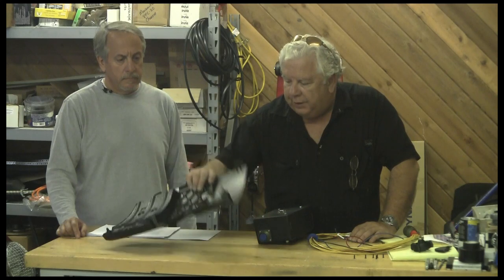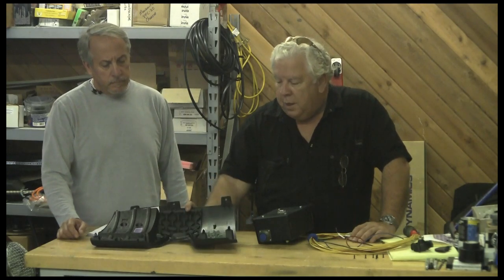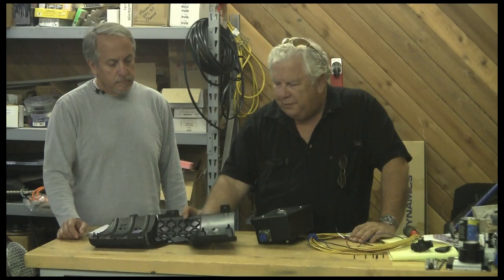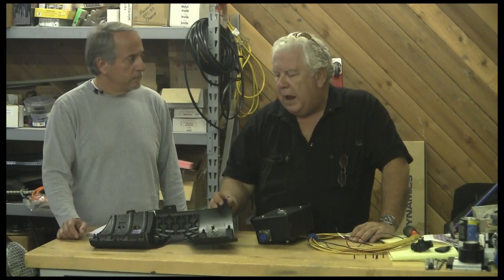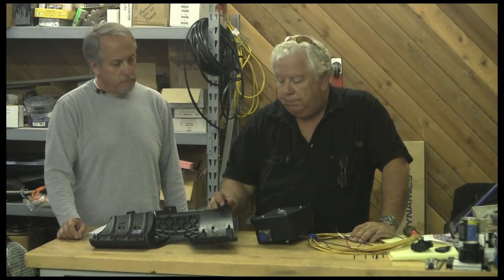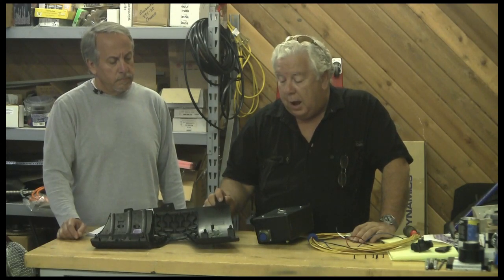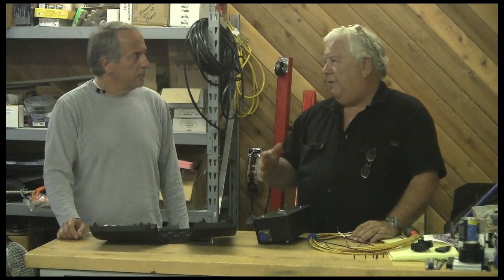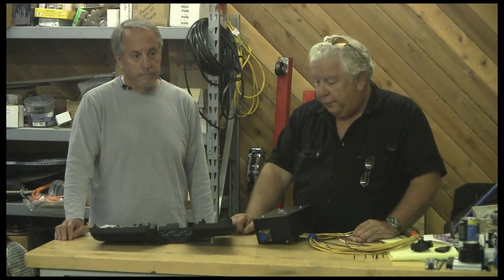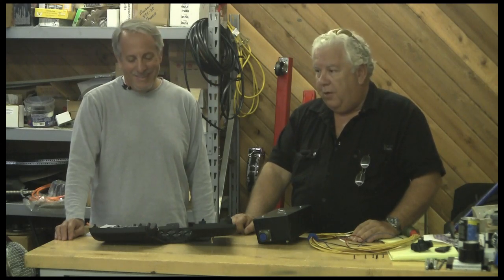Let's talk about some of the pieces. You've seen Brian's installation of the display. This is a little circuit board. The various components talk on a CAN bus. It's a bus for automobile computer networking that was proposed some years ago — it's been adopted pretty widely, but it's kind of a signaling system like Ethernet. Everybody makes up their own messages, so everything can talk to each other on the CAN bus but nothing knows the messages of the other piece.